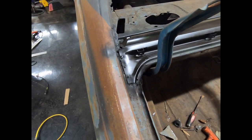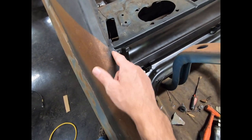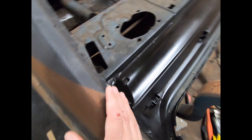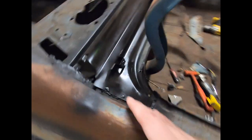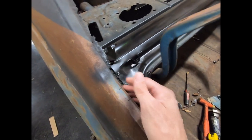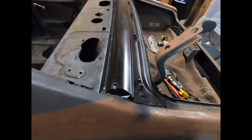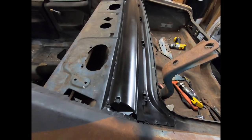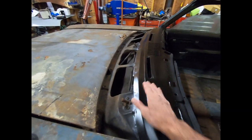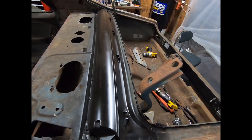Let it dry, got it cleaned up, and then we got the panel fitted. It doesn't fit real well on this side — the other side fit much better. I don't think it'll be too big of a deal; they'll just use a little thicker urethane when they put the window in. This side's not flush because the panel wouldn't go down any farther — it's hitting the hinge, so something over here is damaged. I beat on it as much as I could. I'm going to put a link to this panel on Amazon in the description — might be cheaper elsewhere, but Amazon's shipping is free and it's easy to return if it gets mangled in shipping.